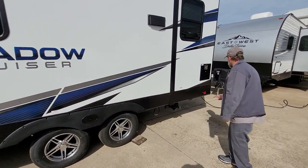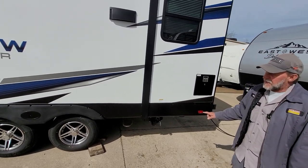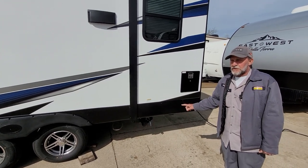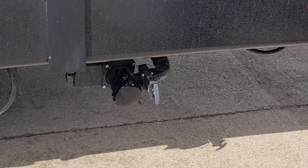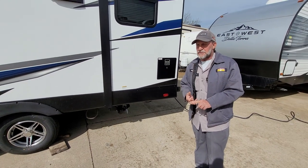Your first connection in the back — the black tank flush is on the back of the trailer. Your three-inch valve in the front will get pulled and drained, then you can hook your black tank flush up to it and clean out the inside of the black tank only. The two-inch valve in the back is your kitchen sink water, your bathroom sink, and your shower water.